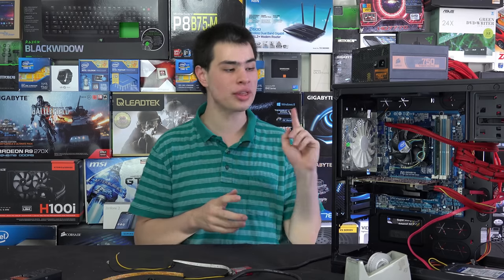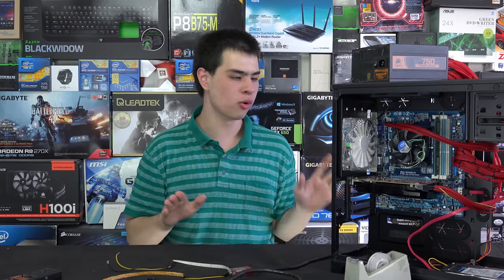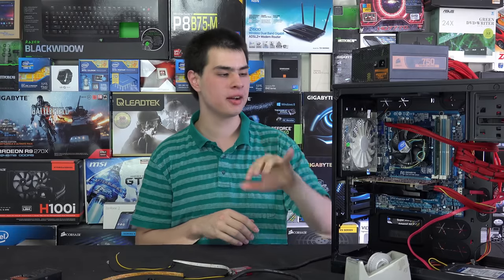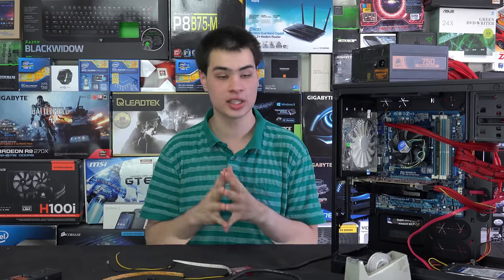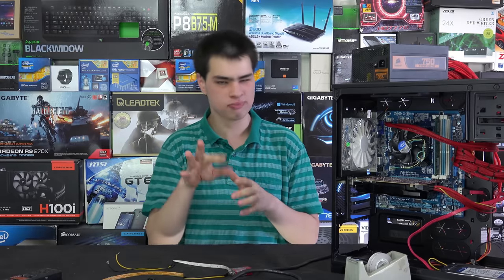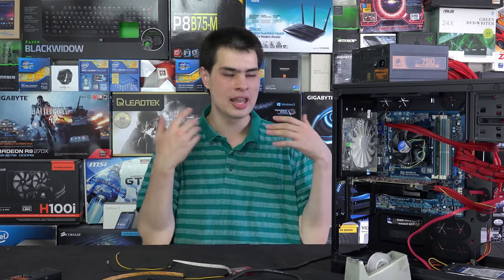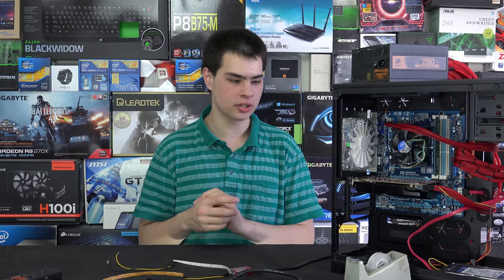So it turns out all the headers on the motherboard for fans are dead. They don't work anymore, all gone. So I wired the power supply straight to that fan and it worked just fine, so it looks like something may have happened there. But in fact, the rest of the system worked just fine. All 4 gigs of RAM registered, the i7 registered for 20 minutes, then blue screened as it was doing before. The motherboard worked kind of, the one USB port that was working before continued to work. The only thing that really died out of this whole project was one fan header,